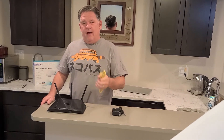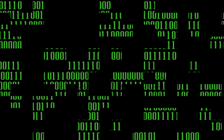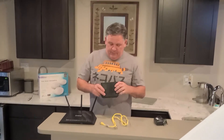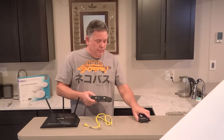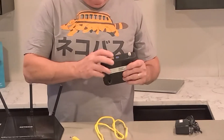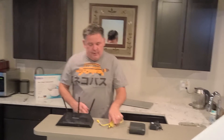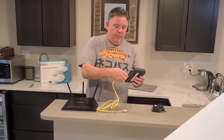I'm going to get my cable modem, show you how to hook it up, and then we'll go from there. I've got my cable modem over here. Your cable modem might look a little bit different, but basically you're going to have a black cable that comes in and attaches here, a power cord, and a place to stick our yellow cord. You're going to hook one end of the yellow cable right into the back of your cable modem.